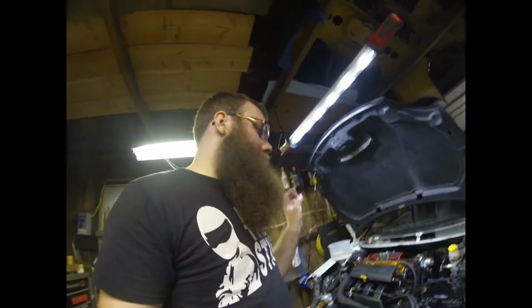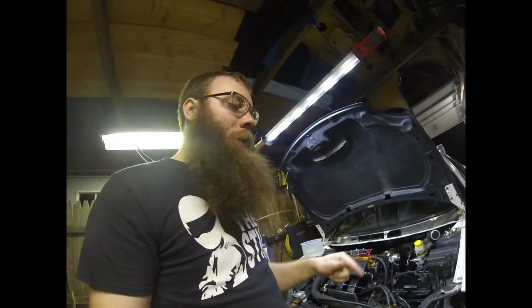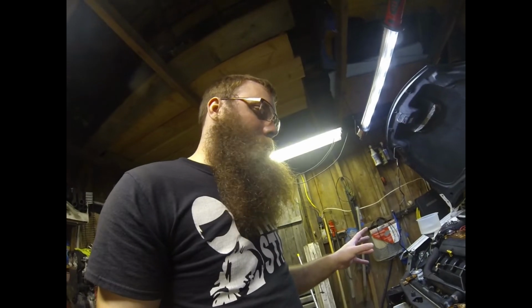And then if I can get that done, then I can come over here, slip those in the suspension real quick, get that kind of eyeballed and set up and ready to go. And then I can come back over to this car and start getting the cluster and the gauges mounted. And once that stuff's ready to go, then I can try and disable the fuel and ignition, crank it over, get some oil pressure. And once we got good oil pressure and I know that we got good oil flowing to the turbo, then I can try and hook everything back up. We'll put some fuel to it and fire it up.